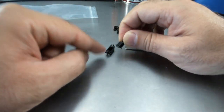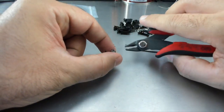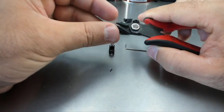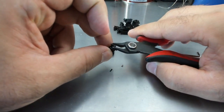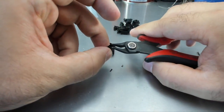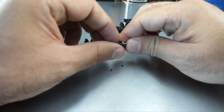There's suspension so when it hits the bottom it lands on those first, and that provides some cushioning. But we don't want any cushioning — we want a real loud keyboard. We want it to make a big, thwacky noise. So what we're going to do is just clip those off. We're just customizing it a little bit. I'm going to do that to all of these.